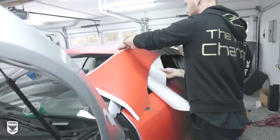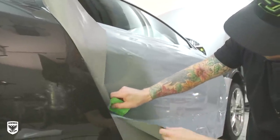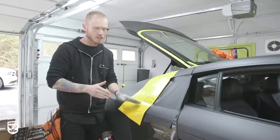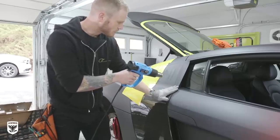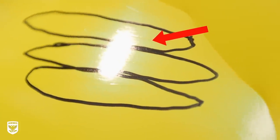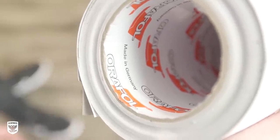About 50% through the installation, I asked Christian if he saw any difference with this new Oracle material. He said the car was coming out amazing. With previous gloss films, air channels in the vinyl collapse over time due to heat and tension, creating adhesive buildup and glue lines. But with this matte finish, it's the most pure finish he's ever seen — no glue lines at all. Glue lines are the Achilles' heel of wraps and make the finish look worse. With this material, they don't have that problem.